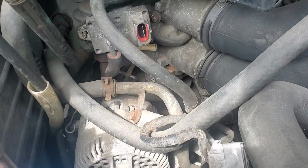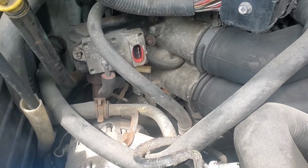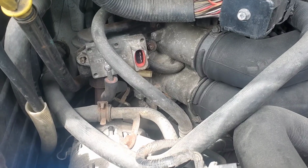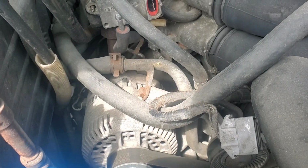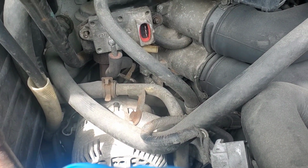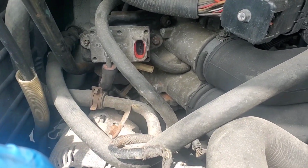In any case, this is like an analysis. I think if I put in the EGR valve and it still has the same issue, I'm probably just gonna see if there's any problem. I know there's a couple of things at the bottom. The main ground wire seems to have a really bad, really rusted connection on here. So I'm gonna change that and I'll see if that actually fixes the problem. I don't know what else I could look at as far as that's concerned.